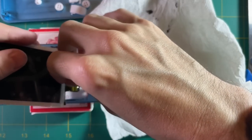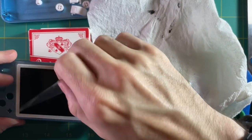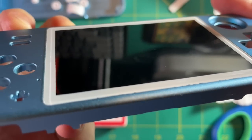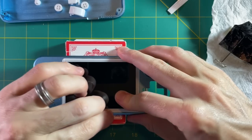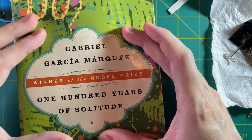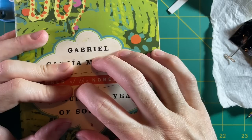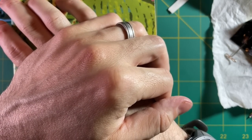I'm working pretty quickly here because I'm worried the glue is going to dry out. I remove the protector and just kind of push it together, then made a point to remove all the excess adhesive. After it all dried, I was able to get my fingernail in there and scrape out the rest of it — it looked really nice afterwards. Because we're not using super glue, it's going to take about 20 minutes of pressure to keep the screen in place. You could use a rubber band, but personally I used a book — 100 Years of Solitude by Gabriel Garcia Marquez, one of the greatest novels of the past century. I stacked a bunch of other books on top of it, walked away, and came back 20 minutes later.